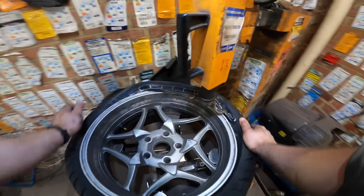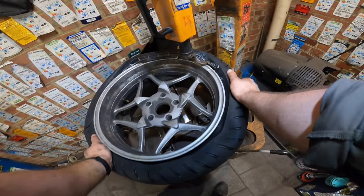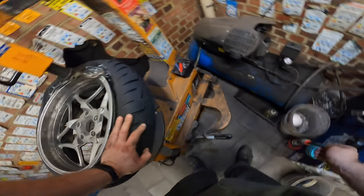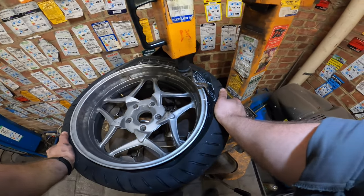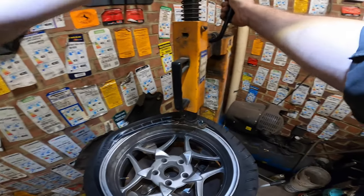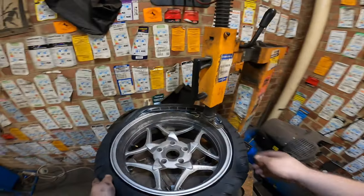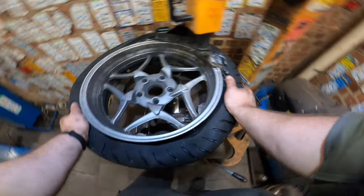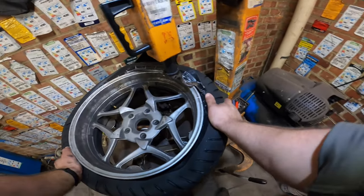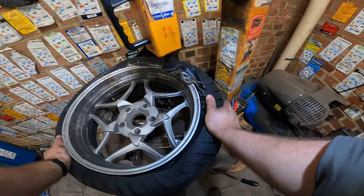And even with the machine, it's pretty, pretty risky. Again, in case of doubt, lubricate. You don't want to rip the edge, of course. If it seems like you're ripping the edge, lower the machine just a little bit. Voila. Make sure you're not making contact with the rim. Barely not making contact. Voila. You just went a little bit further.